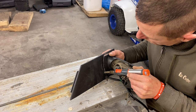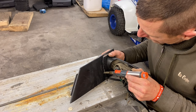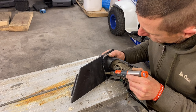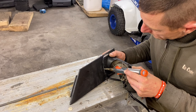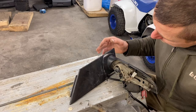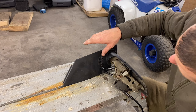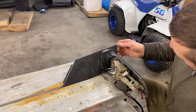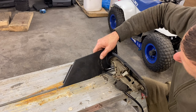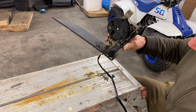You can use fibreglass, fillers, glues and all sorts but this is what I prefer. I repaired an Audi A4 bumper once - it was a very rare one, only about 200 ever made - and the bumper turned up in pieces in a box like a puzzle. I literally plastic welded it back together like this and it never broke again. That is absolutely solid. I need to make sure it's all below the surface, go all the way around, lightly sand it smooth, then a skim of filler to make it all pretty. I'll cut some bits of plastic to go in the void and any big gaps - fibreglass maybe on the back for strength but mostly filler. Really happy with that.